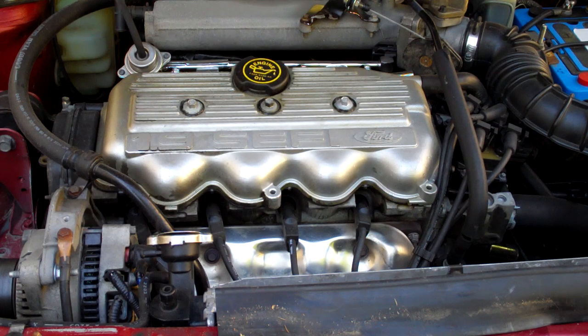Now it's just a matter of pulling the engine out, tearing it apart, and seeing exactly what's going on. At least we know exactly where we need to be looking — you've got to take a good strong look at everything around number one cylinder. So there you go. That's what a rod knock sounds like and that's how to diagnose it.